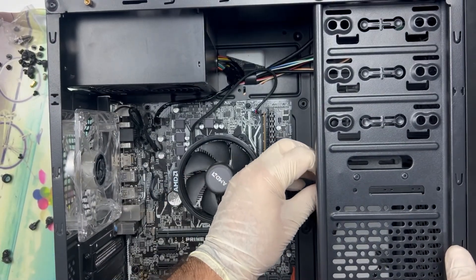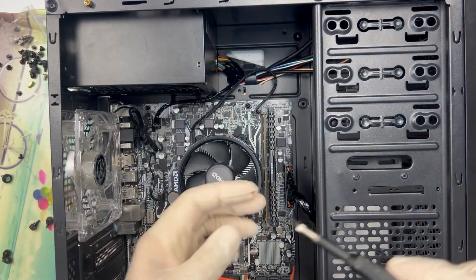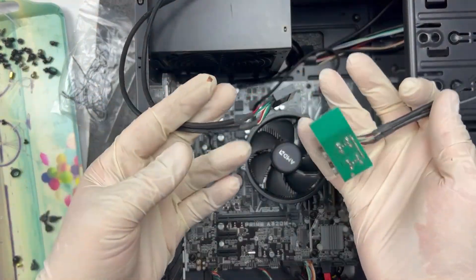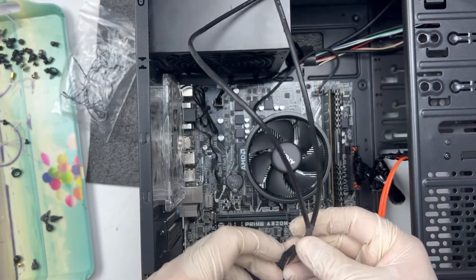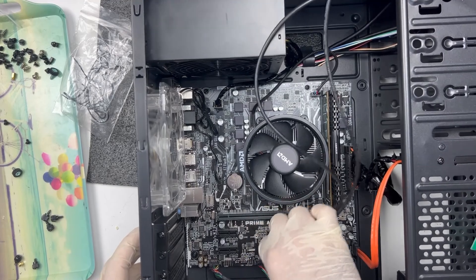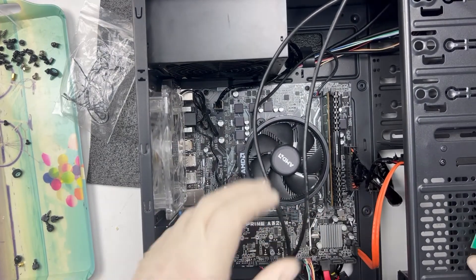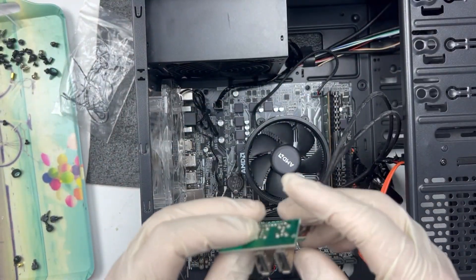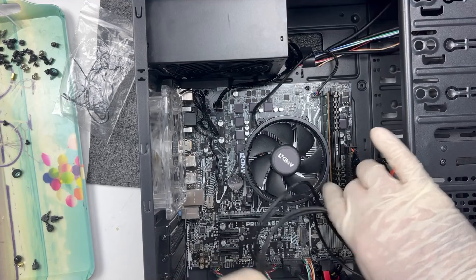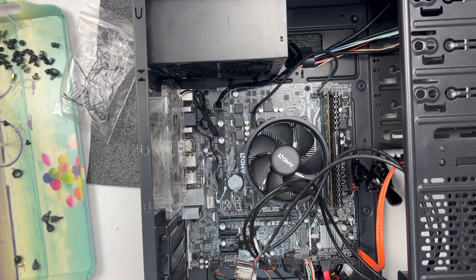My intention for this build is to be GPU-less so that point is moot. I wish I had remembered to change the fan with a less audible one — it's not broken or on its way out, this is just how these PSUs come from the factory. It just irks me a bit that this is the loudest component in the system. Another thing that keeps this PC's price tag down is the fact that although the Ryzen 2400G is part of the 2nd gen family, the core inside is Zen 1, which means it needs some tweaks for Windows 11 to install. It's a ridiculous artificial limitation in my view — entirely arbitrary — because when it suited Microsoft they quickly made an exception for a few Intel i7 CPUs from the 7th generation just because they used them in first party devices that were still supported.